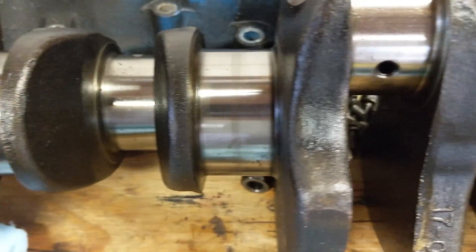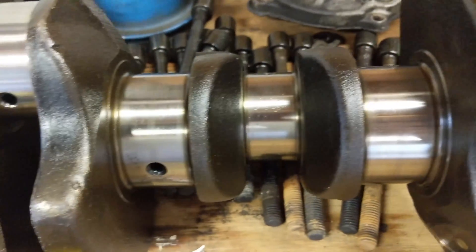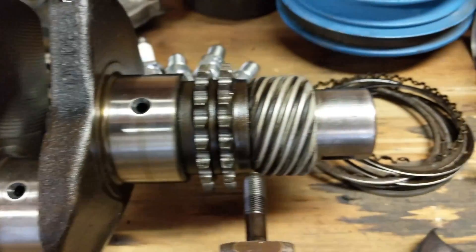I'll polish it up and we'll do that on the next video. Now you've seen the bad pistons and the bad cylinder walls. The pistons right now are half a mill oversized from a previous mill work and we can go up to one millimeter oversized. So the question for you the viewer is: do we stay with the same size pistons and just replace them, or do we go for it and go the big bore and new pistons at one mill?